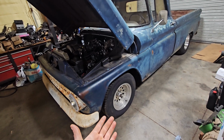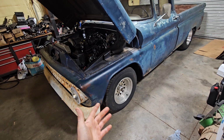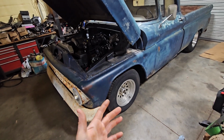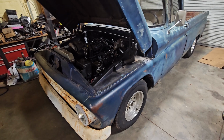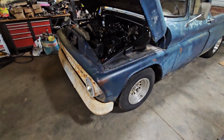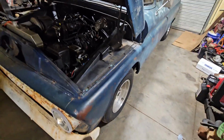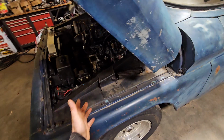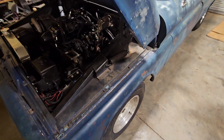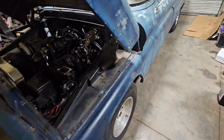So I think they're 10-way adjustable, so I just put them in the middle for now. I was wondering why it was kind of floaty or soft or whatever in the corners and stuff. But of course that might be too stiff now. Anyway, I had forgotten they were there, so I'll play around with the dial on them and see where they go. But dang, that is pretty solid. I might have to take a couple clicks out of that.